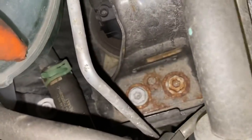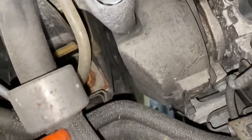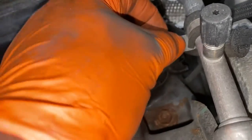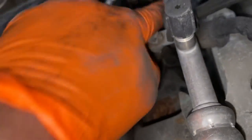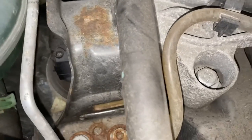About 16mm bolts. I'm going to remove those. Get these fuel lines off. The high pressure pump. And take this 10mm off. And the aircon pipe. And there's another one down there. And then we'll start removing all of this. But first, support the engine with a jack. As you can see, I've got one over there.